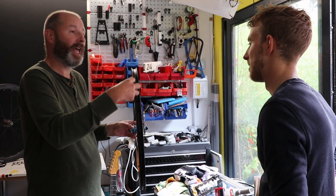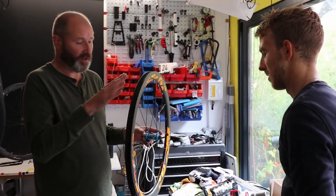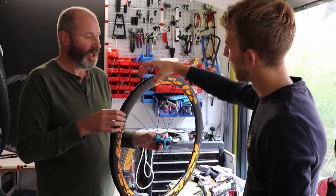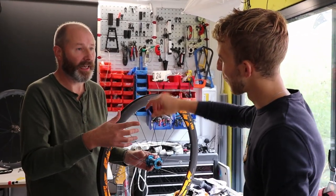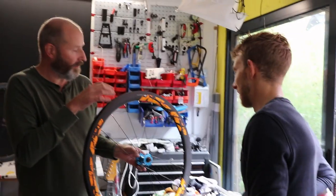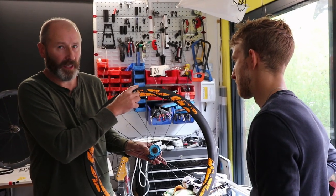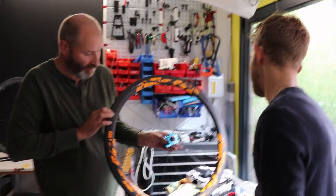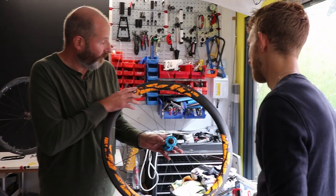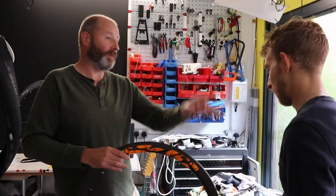And if you lose the stiffness here, you need more air pressure, and then you get a worse ride. So from my point of view there's no difference whether this is going to be used for disc braking or rim braking — you want it strong to handle the load and the flex. So if I wanted to make this as a disc-only wheel, the only thing I might change is make the graphics a bit bigger, but I wouldn't change how this rim is structured, because that would affect how good it rides and how strong it is. And the point is that this is a full braking zone, and it's a really good braking zone — so you can swap these wheels across all your bikes.